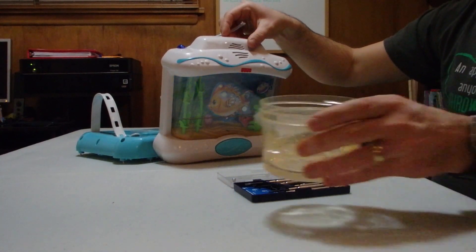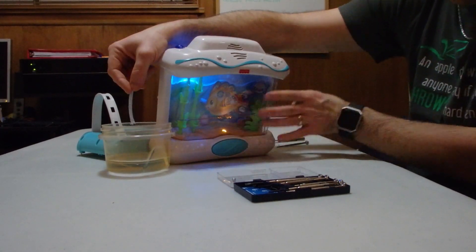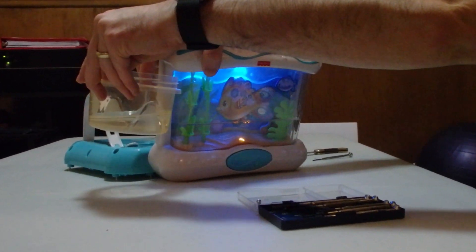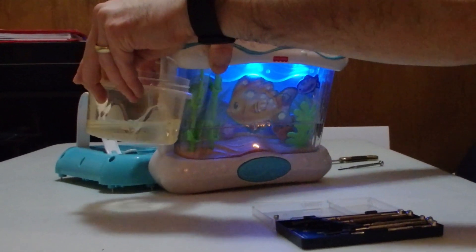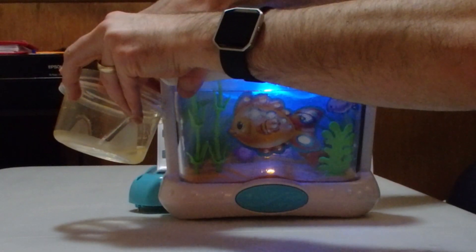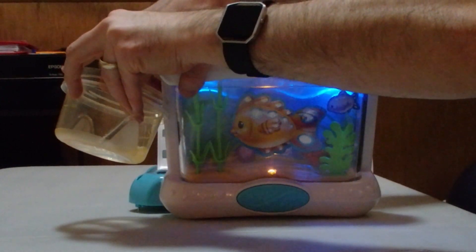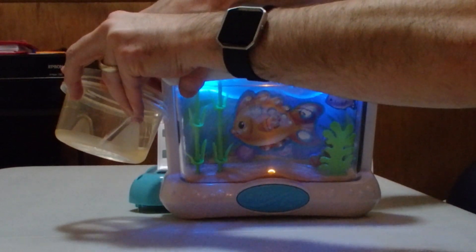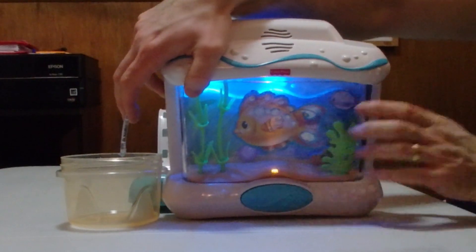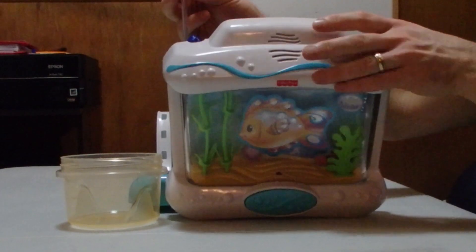Now here's where we need the air inlet. We've got our solution off to the side — turn the light on, and it's just a matter of putting the tube into the solution to be sucked up. As you're filling this up, you don't want to fill it too close to the top. Remember, there's going to be some liquid still on the lines rather than air. So once you get close to the surface, stop, pull the line out, let it suck up some air to bleed itself out, turn it off, and you're good to start reconnecting everything.